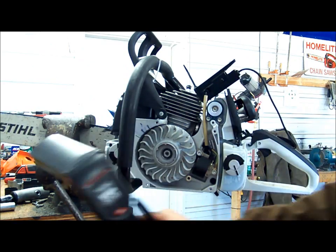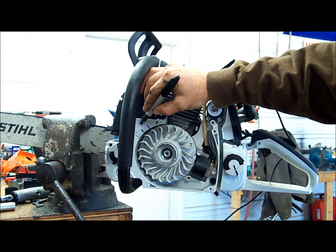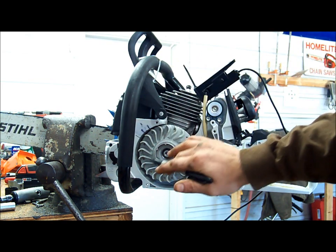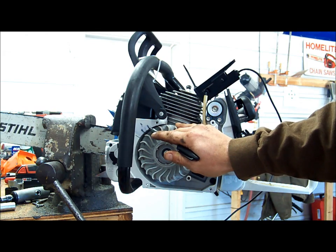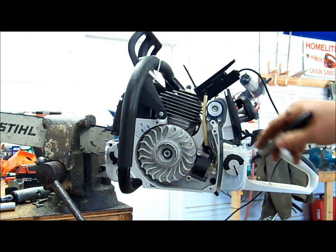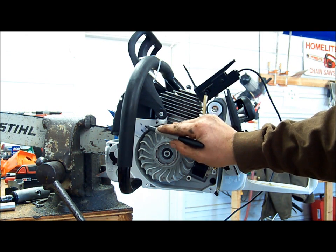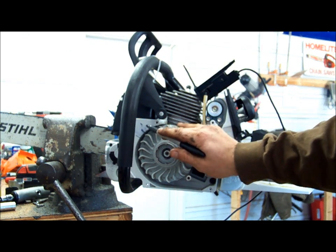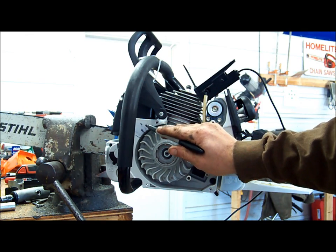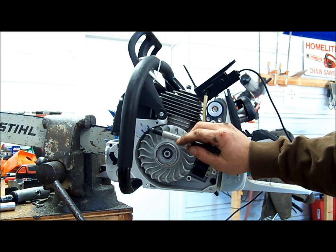The 036 coil doesn't have ignition advance, and it is set exactly in between the two — in between the idle of the 461 coil and the advance of the 461 coil. You can adjust that if you'd like. I don't know if you're going to gain enough to justify trimming the flywheel key to get those couple degrees out of it. Other guys that have been modifying these have said they can't notice a difference in the wood, but that's what I would like to see.